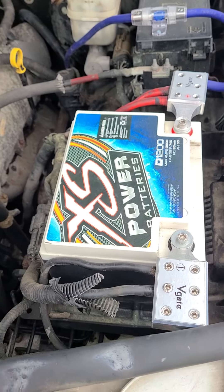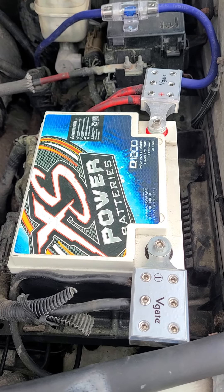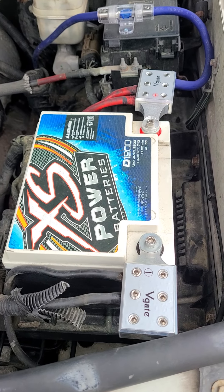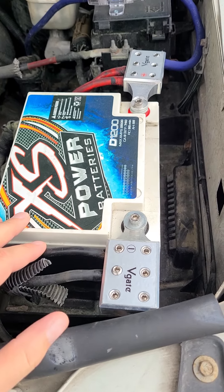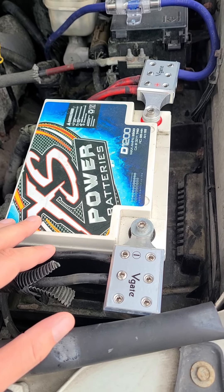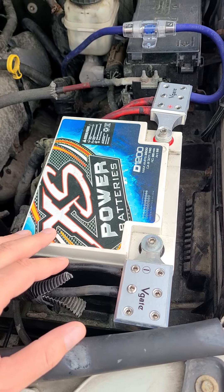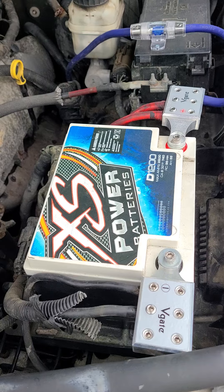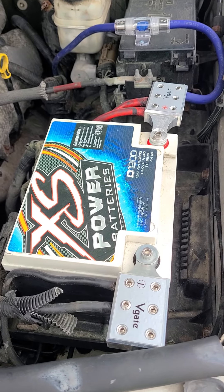I'm really anxious to take you through not only the process of upgrading, but what difference it makes. Right now I'm holding voltage on my Sundown and the JP23 in the low 13s, high 12s depending on the bass note. I'm really hoping to get more out of the amplifier — pull a few hundred more watts, limit the clipping. I'm really hoping this thing can stay in the 14s, ideally maintain a 14.4.